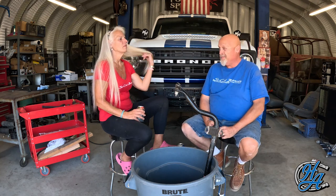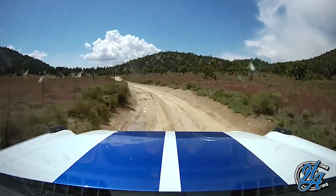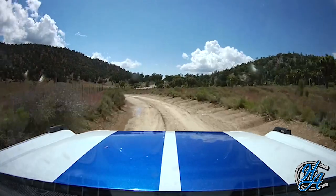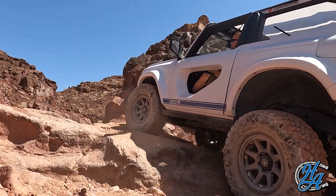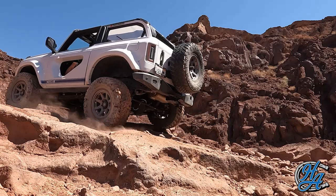As a daily driver — I drive this thing to work every day and I've probably put about 5,000 miles on it since I took the sway bar off — no problems at all. Yes, there's a tiny bit of extra body roll when you're hauling ass in the corners, but off-road it just works like a champ, and it actually works better in high-speed off-road and whoops. Rock crawling, it's night and day. It probably only gets maybe an inch or two of extra flex, but that's just enough and it makes a world of difference.